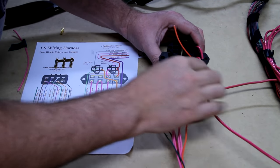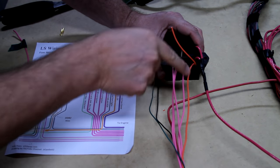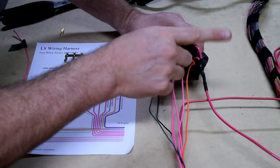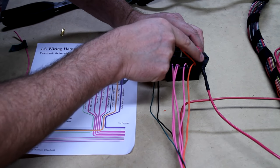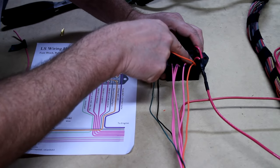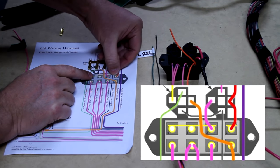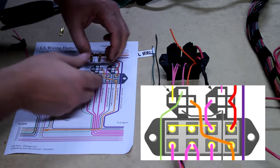Here's where I've got the main power wire, represented by red on the diagram, coming in. Everything is going to exit down here - while it's drawn at the top in the diagram, I'll have it exit through these pieces of rubber. I come in here and split it, going to the top side of the fuse and also to the input of the relay. The metal piece in here used to be connected to this piece and you just have to clip it off, because in the diagram I've separated one and two. But two, three, and four I've got to keep jumpered together, so I'm not going to clip those apart.